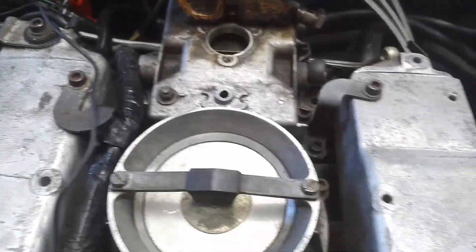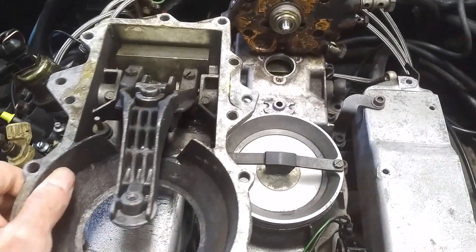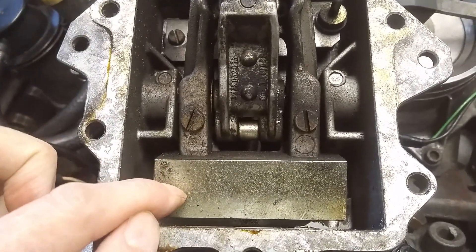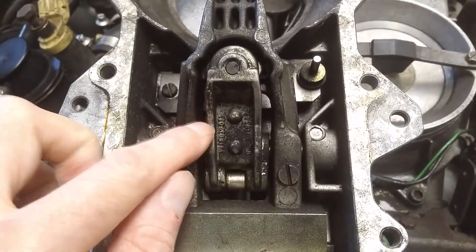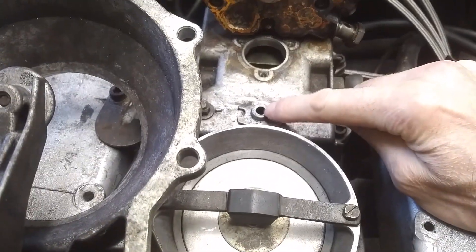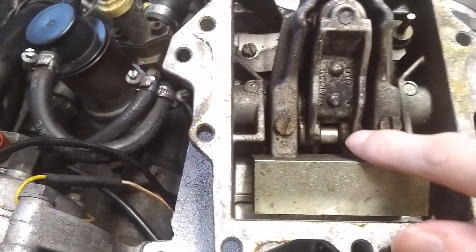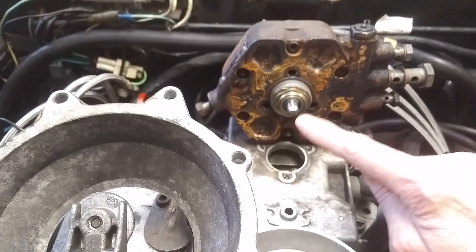The actual seesaw mechanism is worth a look, which is why I've got one here — this is one I had to pension off because someone had messed around with it so much that I couldn't fix it. There's a bunch of adjustments here that are all set at the factory, like the position of the counterweight. When you adjust the idle mixture and drop your 3mm allen key down that hole there, you're dropping it into the back of this screw, and it sets an offset between the big lever arm that the flap's pushing on and this little lever arm here, which adjusts the position of the little roller that this bit rests on.